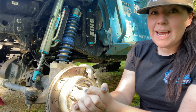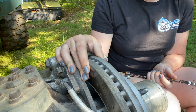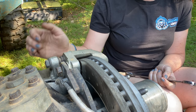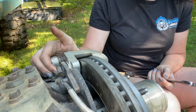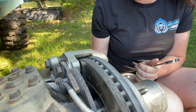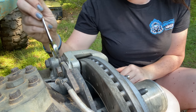We need to get the brake caliper and the rotor out of the way so we can service this hub. My fusion axles came with the Chevy 3500 brakes in the front. This caliper is held on by two bolts — one up top and one at the bottom. These bolts should have a ton of Loctite on them. I can't get a socket up top but I can use a socket underneath. You need a 21 millimeter wrench for this — just going to loosen that up.